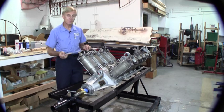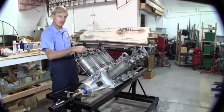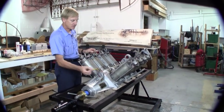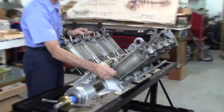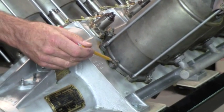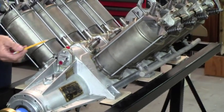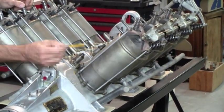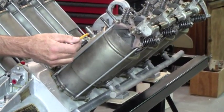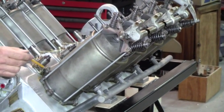We now have the eight cylinders and piston assemblies installed on the engine block — one, two, three, four, five, six, seven, eight; number one at the rear of this engine. The cylinders are held down by eight studs and nuts. Initially on the OX5 they used to hold the cylinders down with eight nuts at the bottom, but they found they had a few problems with the barrels cracking, so Glenn Curtiss went over to a stud arrangement — four long studs and a spider holding the cylinder down on top and four bolting down the bottom.